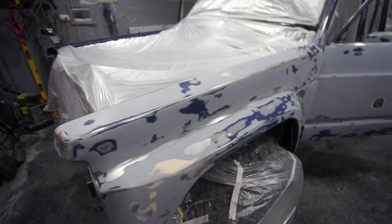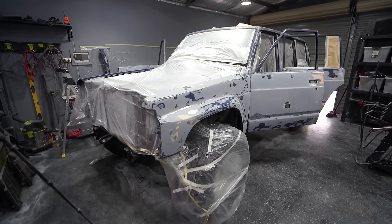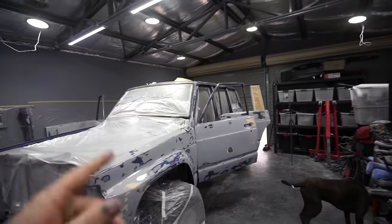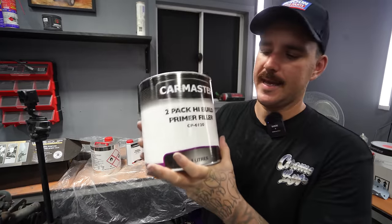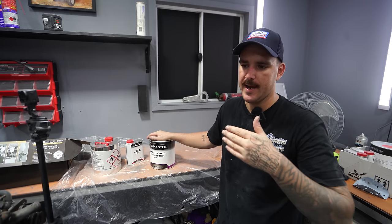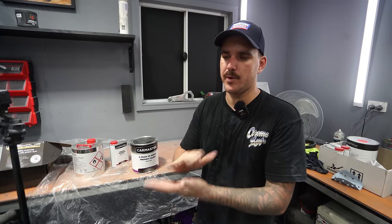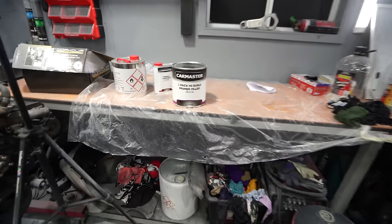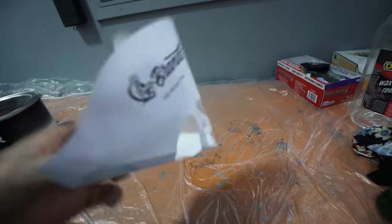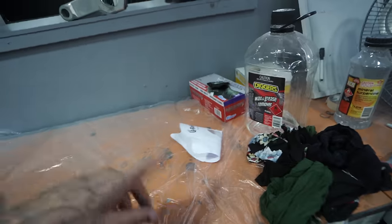We've got this thing cling-wrapped up. I've gone ahead and wiped everything down with wax and grease remover — that is a very necessary step. Get all the dirty fingerprints off, and once you've wiped it down, do not touch it with your grubby hands. Put gloves on if you need to shut a door. The product I'll be spraying on first is a primer high filler. There are heaps of different options — 1K or 2K. This is my first time spraying 2K because we are putting a 2K paint on top, so it's best to go 2K underneath something hard. I started using these paint filters now — the gun was clogging up like crazy. I'm going to mix this up and get this car one color.